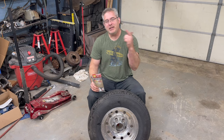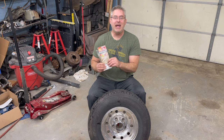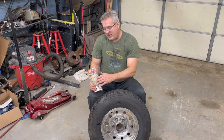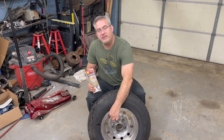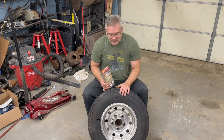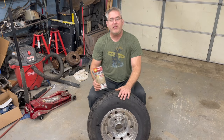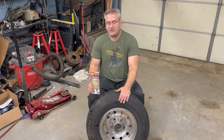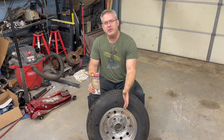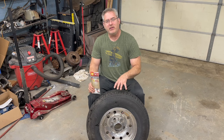Welcome back to Broncos and Parts Garage. My name is Chris. If you're new to the channel, stick around at the end — you'll see additional links for content we've already created. Today we're going to do something a little bit different. I've got this AME International valve stem replacement kit. They claim in 10 seconds you can pull this valve stem out and put a new one in while leaving the tire on the wheel. In front of me I've got a nice Alcoa wheel that came off a 90s Ford truck. On modern trucks, you won't be able to do this because they have a tire pressure monitor system inside, so you will have to take the tire off the wheel.